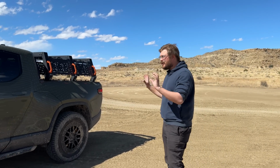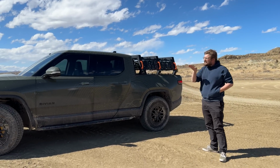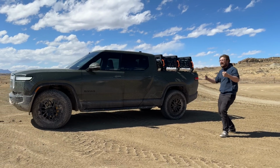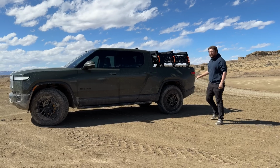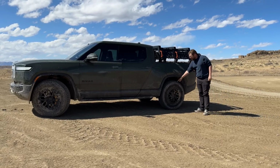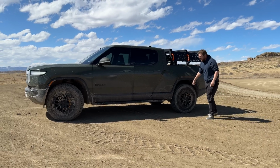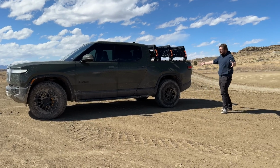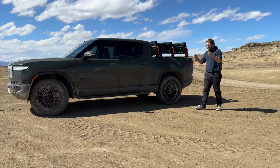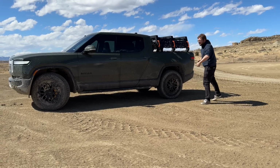I have been complaining about my 4-motor system in a lot of situations, unlike a situation like this, but actually if I'm hooked or stuck inside a rut and I need a lot of power to get me out, and there's only one tire with traction, one of the problems with individual software control is I can't put the total power of the vehicle or even the total power of the axle to one tire. What happens with the 2 independently controlled motors, let's say this is the only tire with traction, which happens a lot off-roading here, low speed on some Colorado trails, you're hung up, 3 tires are spinning, and you just need that 4th one to get you up and over.